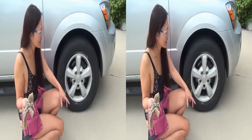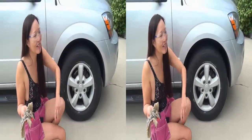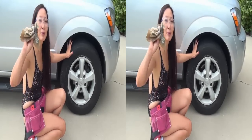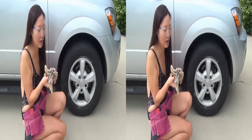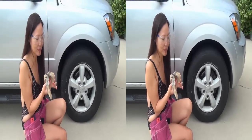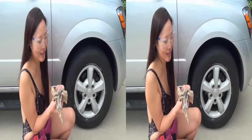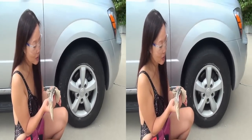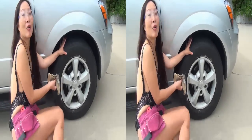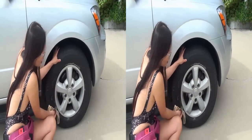We probably don't have to but we decided to do it anyway because we also have a clear coat. This way we take it all down and then do one coat of clear coat to make it all look nice and finished. So one of the first steps is we have a nice cloth — actually the cloth that we use are old bed sheets. I always figured old bed sheets, when they're talking about 300 thread count, that's a pretty nice cloth. So it makes a great cloth to rub on compound. We tip the compound very generously — as you can see, wiped it all over the place.